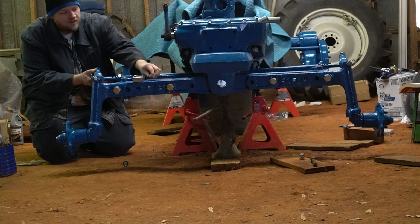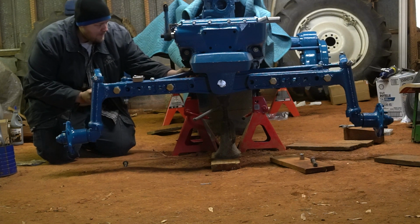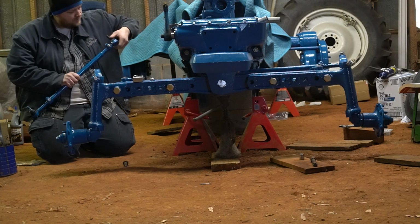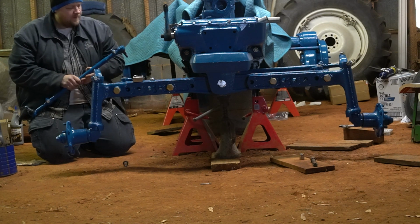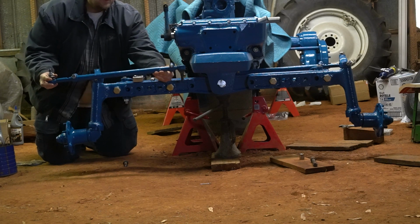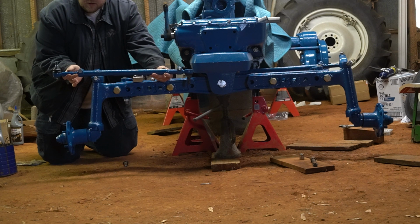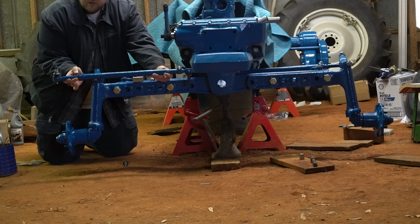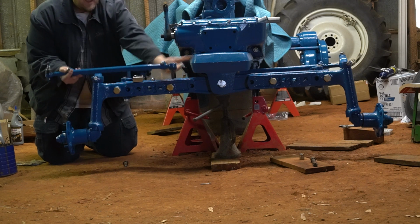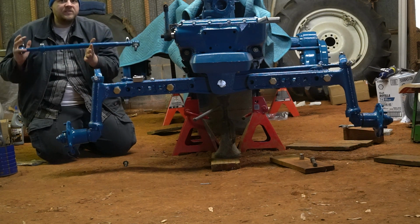So I'm going to take and turn each one of these inner joints one more turn. Which is basically bottomed the thread out on this one. So I may come back and slide this outer joint to the 2nd notch instead of the 3rd notch, which will then extend this one out. And that's just so I have adjustment once I get the tires on.